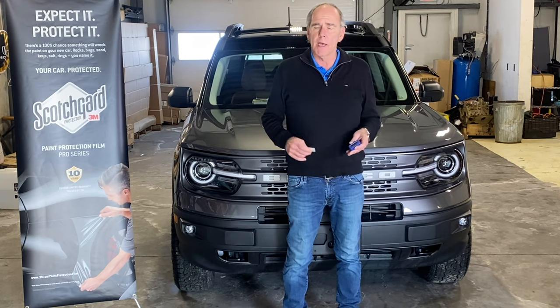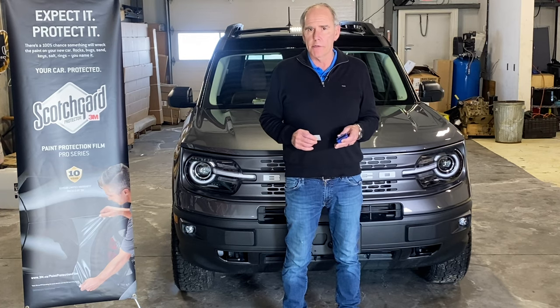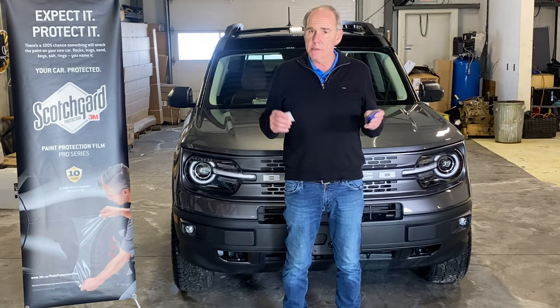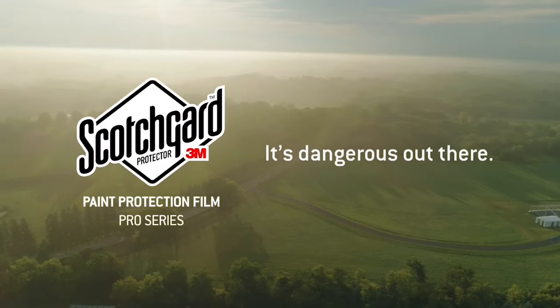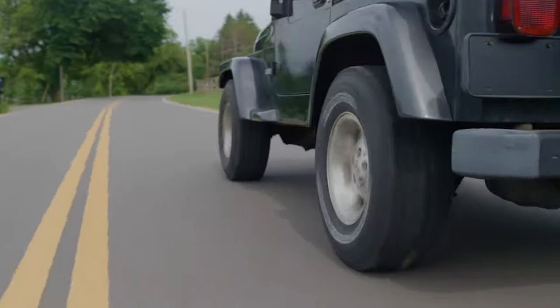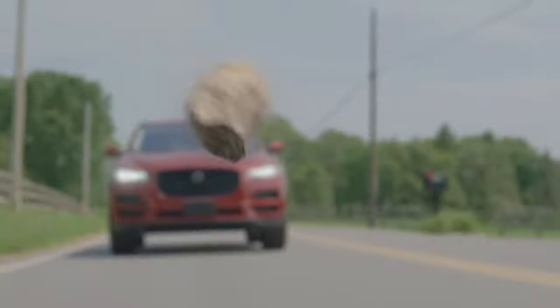Today's paint — with water-based paint and with manufacturers trying to achieve lower carbon emissions and less time in the dryers — the paint is very hard and brittle. It's often on your hood, on top of an aluminum hood, and those stone chips can cause corrosion on the aluminum and those nasty big blisters.